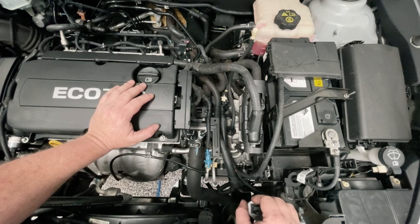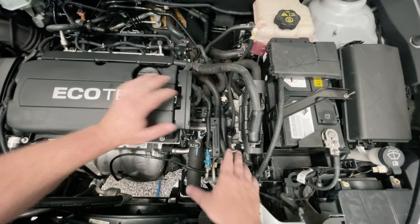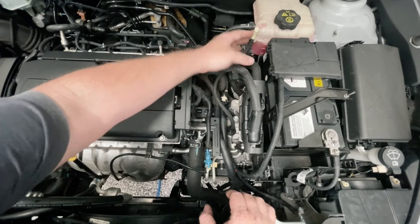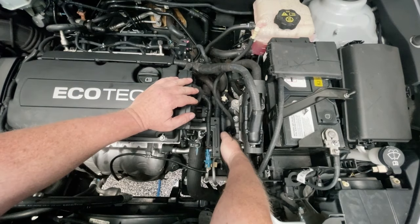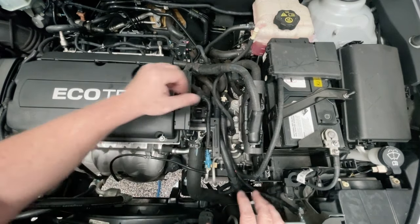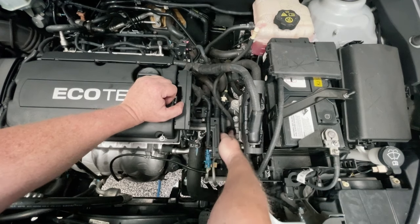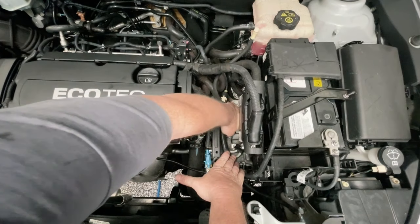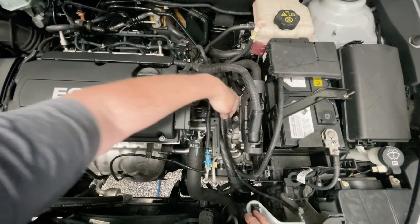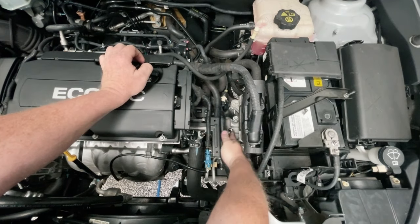These don't have any sort of a dipstick to check, which is just a stupid design, but hey, that's what it is. So what I want to do is this hose that you can see coming up to beside here — it's a fill point on your transmission down here. You can remove some things like this computer to get a little bit more space, but you need to check it with the engine running so it needs to be back on anyway. So you can just get your hand down in here and wind out that filler plug. It comes out like that and now you can quite easily see that fill point.